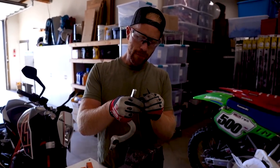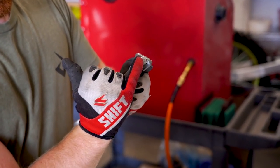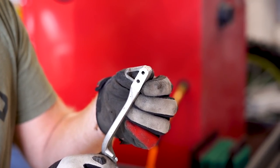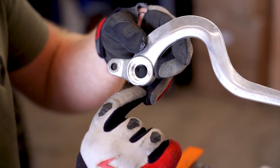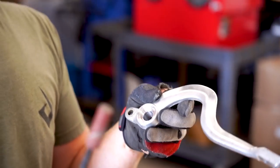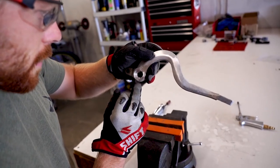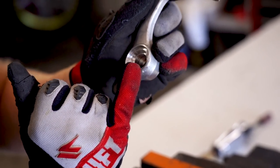Tip is off. Now if you're going to be popping a tip off like we did here, you'll want to grind down the heads of that rivet as far as you can go — and then go a little bit more. If there's even just a little portion of the head on there it makes it a lot harder to pop out. I noticed there's a pretty good-size gouge in this brake pedal that I'll need to smooth out and blend in, so I'm just going to use a sandpaper roll here on the die grinder.